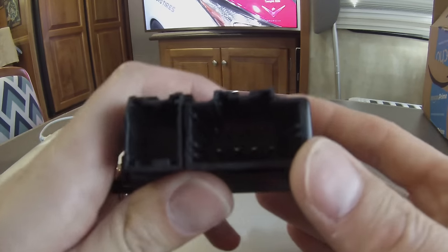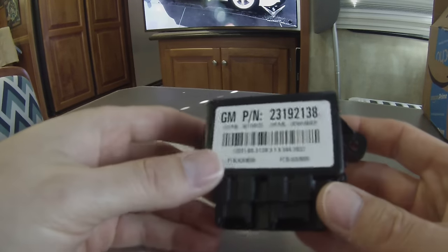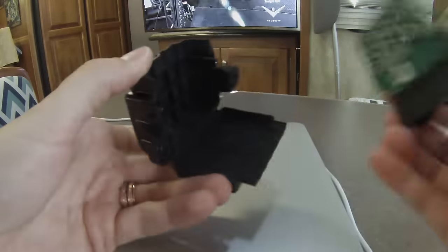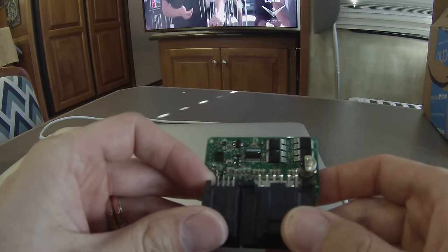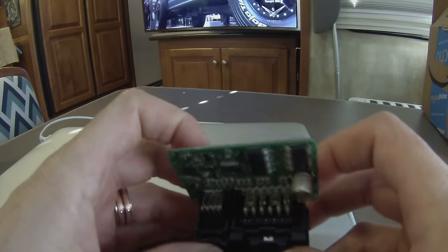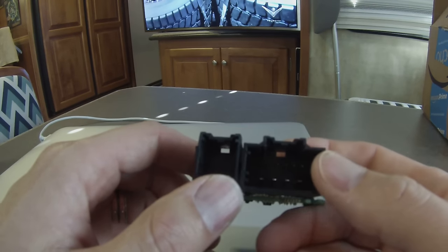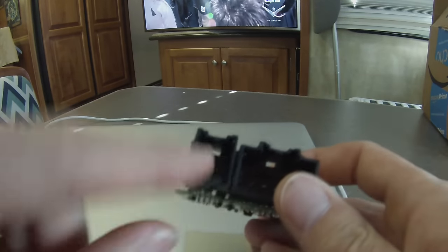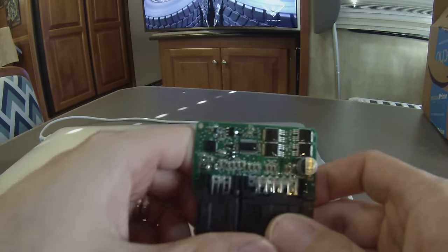This unit is hooked up to your seats. It's one of the easiest units I've ever seen to open up — it literally pops out and you can pull the whole board out to get a better look. You've got an 8-pin connector on one side and a 10-pin connector on the other. The 10-pin side hooks into your seats; the 8-pin side goes to your BCM. On that 8-pin connector you're only using one wire, and that is your LIN bus network.